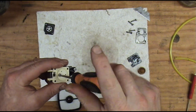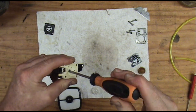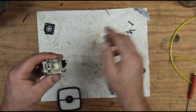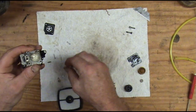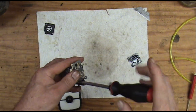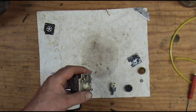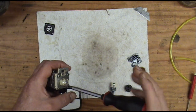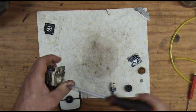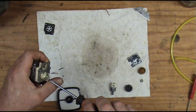It's got one screw that holds this primer block down over the fuel pump diaphragm and the fuel pump gasket. Snug that down a little bit more. Our new primer, then our primer cover — four screws hold all that down. Pull those down evenly. We don't want to tighten one until we get all four of these screws pulling down evenly. Then we'll do the final little torque — pull them down good and even together.